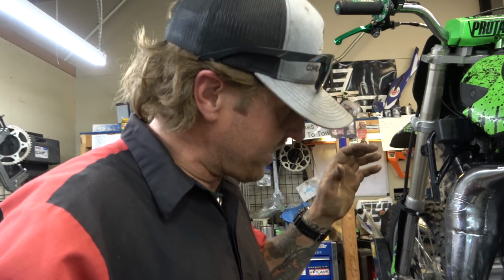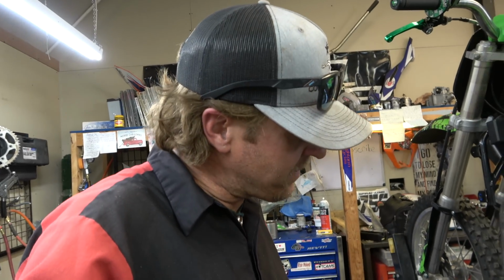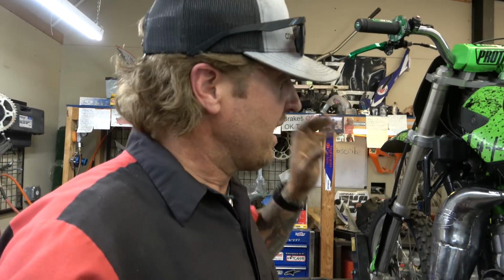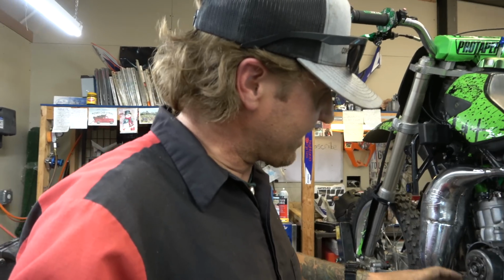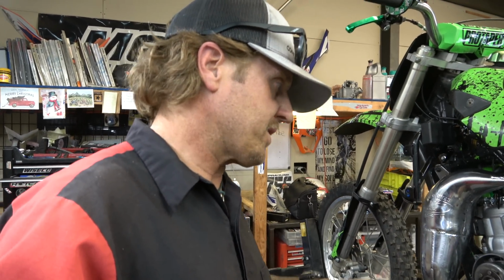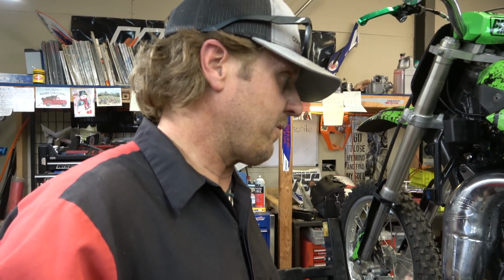And then I put a spark plug on the wire, left the old spark plug in there, kicked it, and no sparks. Then I moved the pickup coil a little bit closer to it, and it started to spark very dimly. So I think we got a stator problem. I took a look at this. I don't have it off anymore, but it was super corroded, and it was corroded when they got the bike. They cleaned everything up as best they could, but I think we got a bad stator.